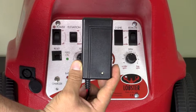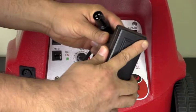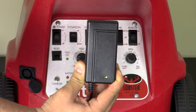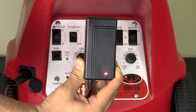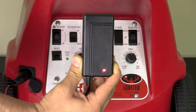If you use a faster premium charger, then your charger has an LED light and we will go over what that light indicates. To test your faster premium charger, plug it into a power source. If no LED light illuminates when plugged in, then the charger is faulty. If the LED light does illuminate, plug the other end into your elite. If the charger light goes solid red, then that means the charger is okay. But if it blinks red and green, this means the charger is faulty. A new faster premium charger can be purchased on lobstersports.com under the accessories category.